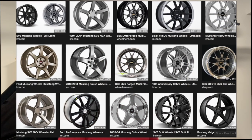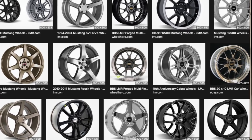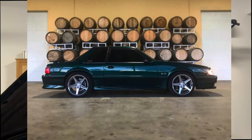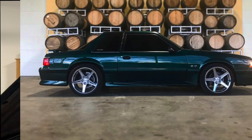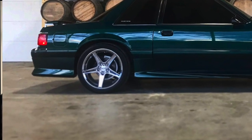That's number one. Number two: wheel options. You just open up a whole new world of wheel options, from OEM style to aftermarket, different offsets — it widens your world by about ten times compared to the four-lug system. And finally, number three: better aesthetics. There's just something about a five-lug rear disc brake setup that just looks proper.